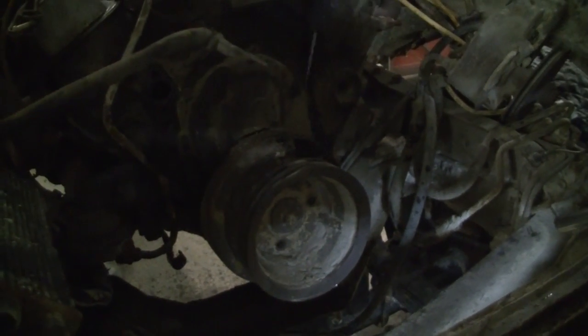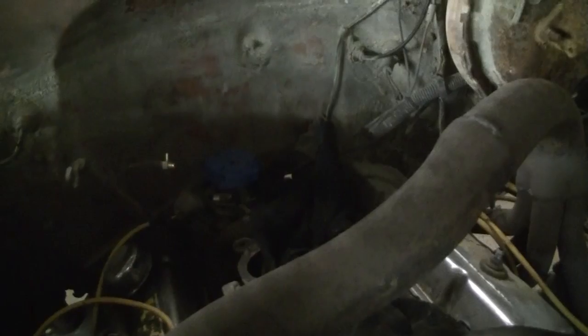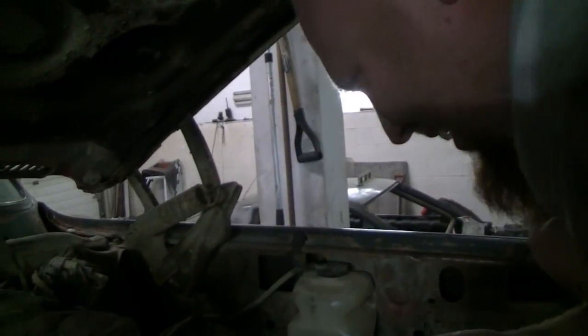Alright, there's a few ways you could tell top dead center. Either from your harmonic balancer, there's usually a pointer up in this general area, but in my case, there's just mud. That, or your distributor cap will be pointing at the #1 cylinder. See that? It's kind of dark. Pointing at #1 cylinder. Or you grab a clean screwdriver, take off spark plug #1 and put it down on the piston, but you got to make sure that it's pointing at #1, or that way it'll be 180 out. It'll be on the upside when it's on the opposite because it's on the exhaust. It's a lot of complicated things and we've tried all three. We haven't done fuck all yet.